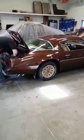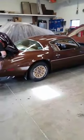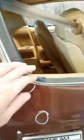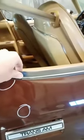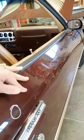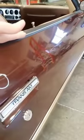There's a bunch of marks on the car right now. I did a walk around and marked out things like dents, large paint defects, and body lines. You can see right there there's some rippling happening. These are actually not even the correct trim and weather stripping, and when the person installed them he used way too much pressure on the sheet metal on the door and caused rippling all the way across the top of the door. We are also marking out body lines so that when we fit everything back together - because we take everything off to paint it - we need to remember what wasn't fitting quite properly and test fit again once we do the repairs.